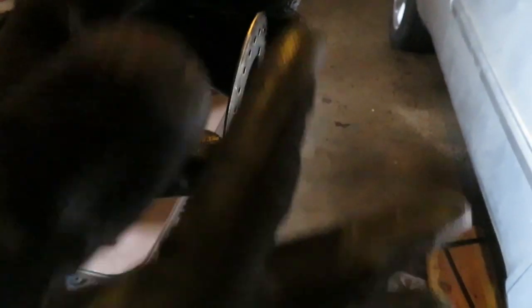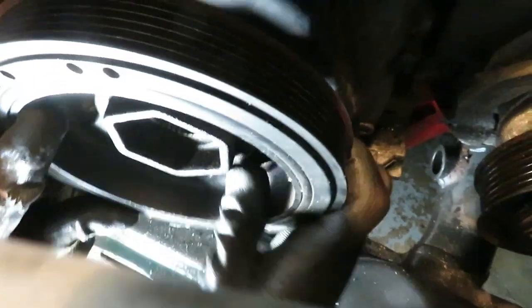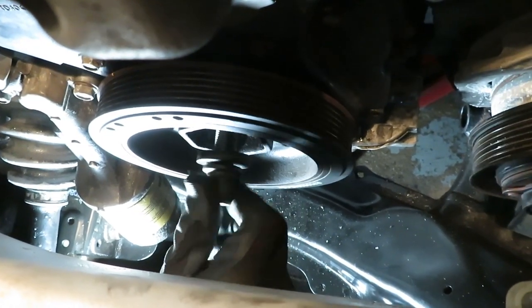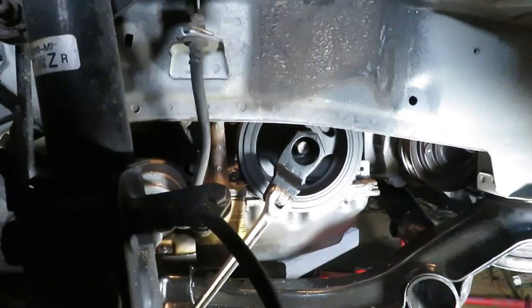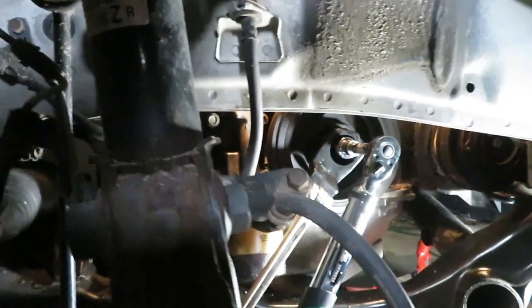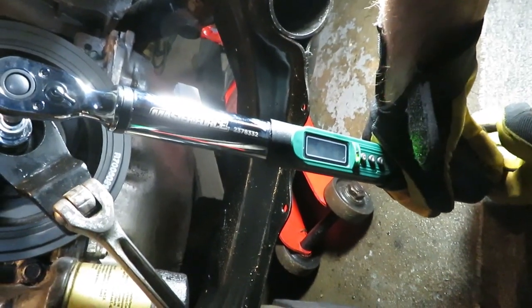Curved out toward the engine. Okay, clean up the top. There's our bolt — Loctite on there. The crank bolt is 47 foot-pounds, plus 60 degrees. So we're holding it like this, up against the lower control arm, and getting into it from here — probably won't have a lot of swing. Hopefully it'll stay in there. It's hard to get much on that. There it is — 47.